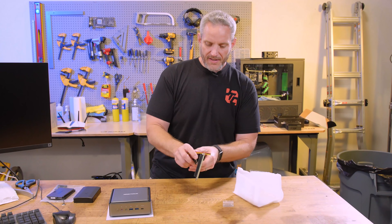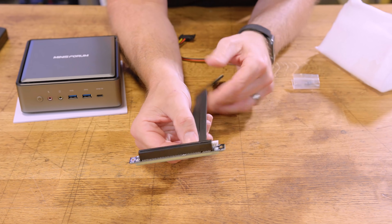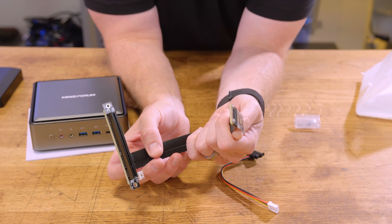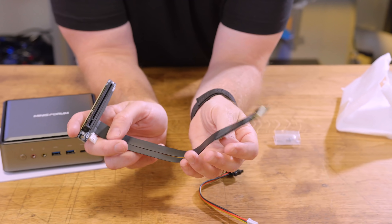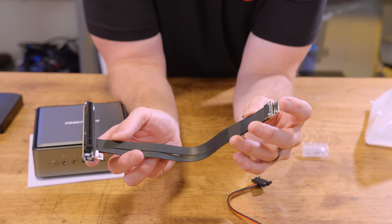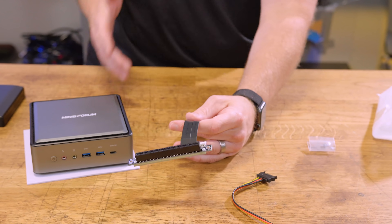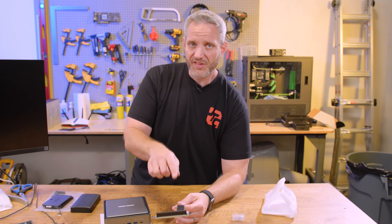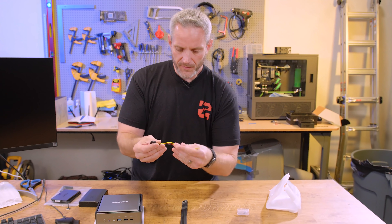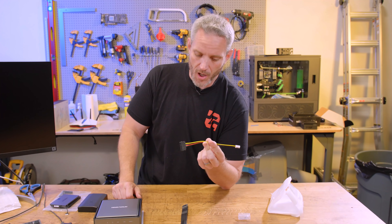Here's what we get: a PCIe slot — this looks like a standard PCIe with supplemental power that runs off SATA. My biggest concern about this is it looks like an NVMe drive, but it's not. It's just an adapter interface that goes from PCIe to NVMe. My concern when talking with Phil was: how are they getting power to the PCIe slot? The PCIe standard says 75 watts through the slot makes its way to the graphics card. They didn't mention supplemental power anywhere in the description, but I ordered two anyway — a long one and a short one.